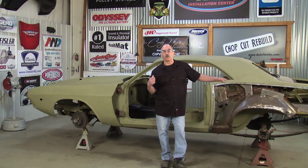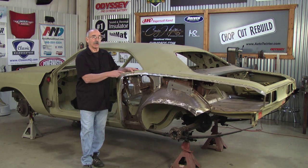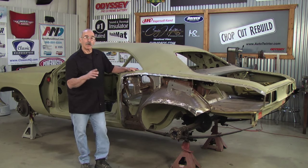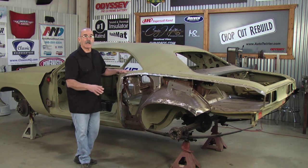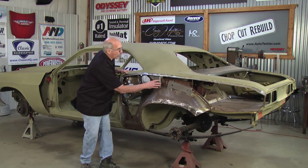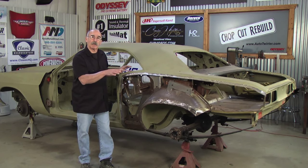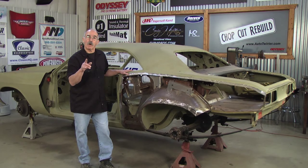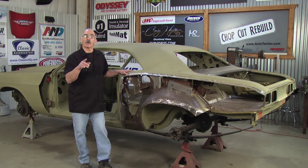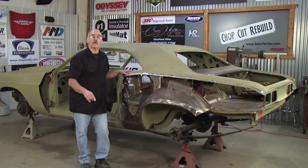The car has an extra problem I want you to avoid at home: they've cut the side off the car in preparation for a patch panel. I don't like patch panels, especially stepped into the car. What's really important is that all the structure has to carry to keep the car level when putting the floor in. The wheelhouse is still tied to the rocker and the roof rail is still tied to the wheelhouse, so the car should be strong enough. If you're putting a floor in at home, don't take the side panels off first — put the floor in first, then build back the other way. Record a couple of measurements from the rockers to the floor and write them down so you'll know if the car has moved.